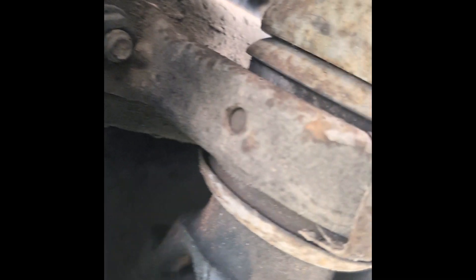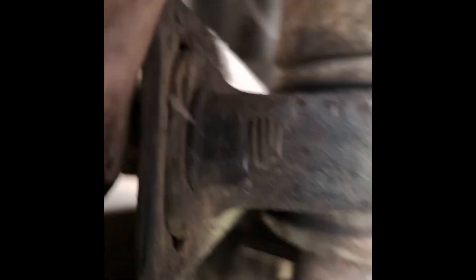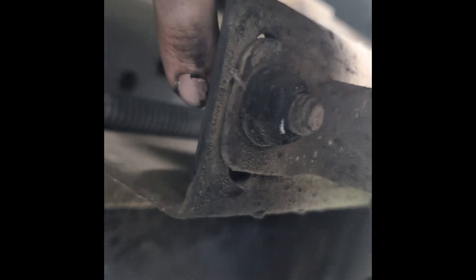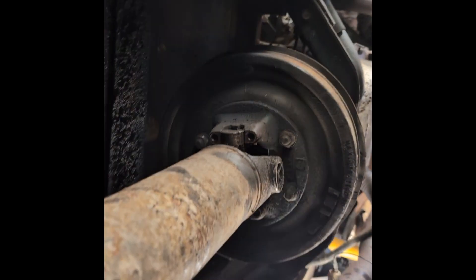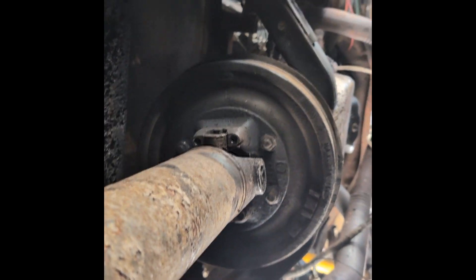Welcome to the carrier bearing. After I got the caps off, the only way the driveshaft comes out is backwards, and currently there's no slack — we need to make slack. We need to take the carrier bearing loose. I thought these were 5/8ths, but they're not — I need something bigger. There are two nuts, one on each side. One is inside of a weird shield. There's a bolt head on the other side that you'll probably need to hold from spinning. When you loosen it, this will begin to droop, and as it droops, geometry says the driveshaft is going to want to come back, giving us enough clearance to get it down.